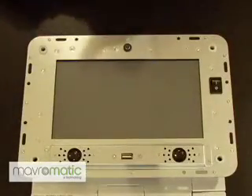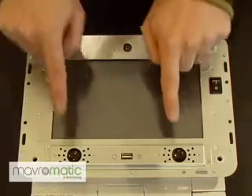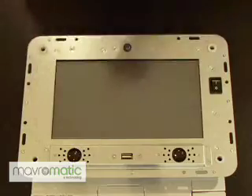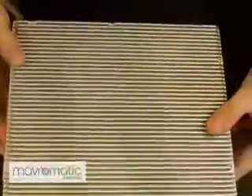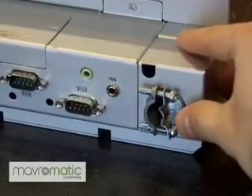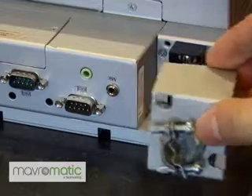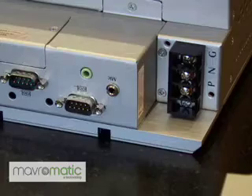There is also an accessible USB 2.0 port behind the front bezel which is perfect for service updates. There is also a power switch, microphone, and two-watt speakers behind the front bezel. It shows that Nobu spent a lot of time designing the system because of all the little details here. Fanless, no moving parts, and it's the only in-wall computer that I know of that has AC power terminals with a proper and legal NMB Romex connector for NEC and NFPA code compliance. Installing this computer in your home, you can be sure that you're not breaking any building codes.